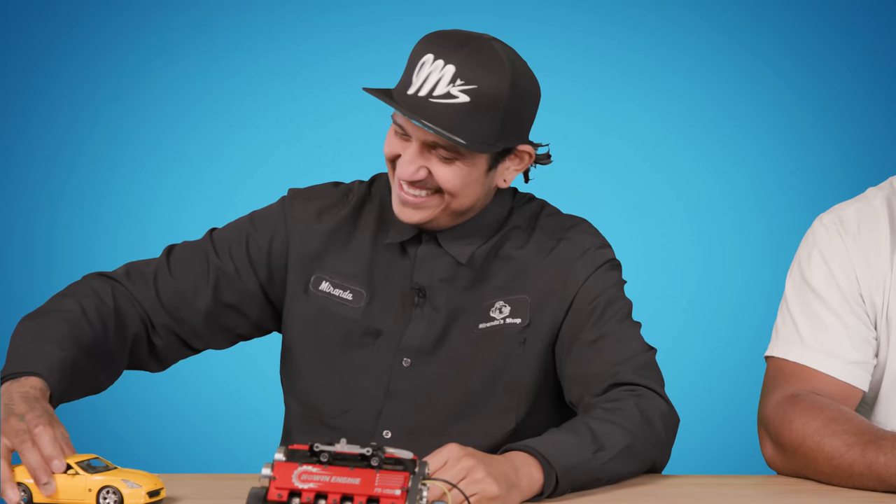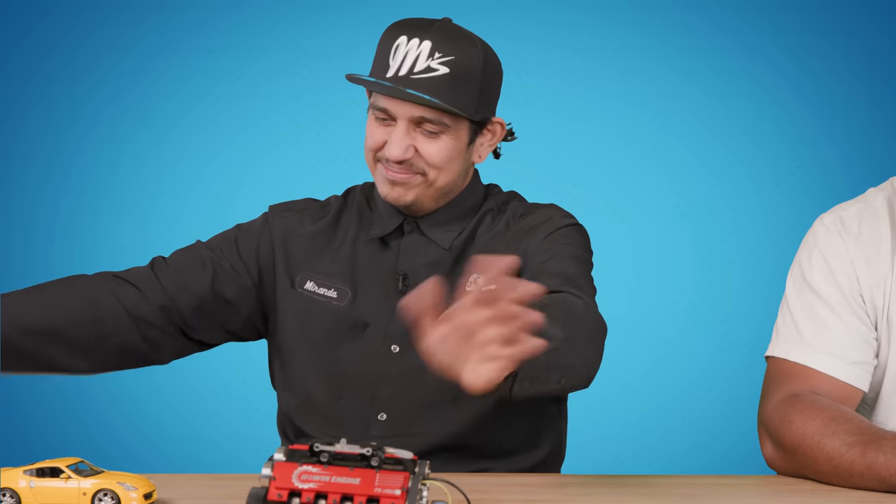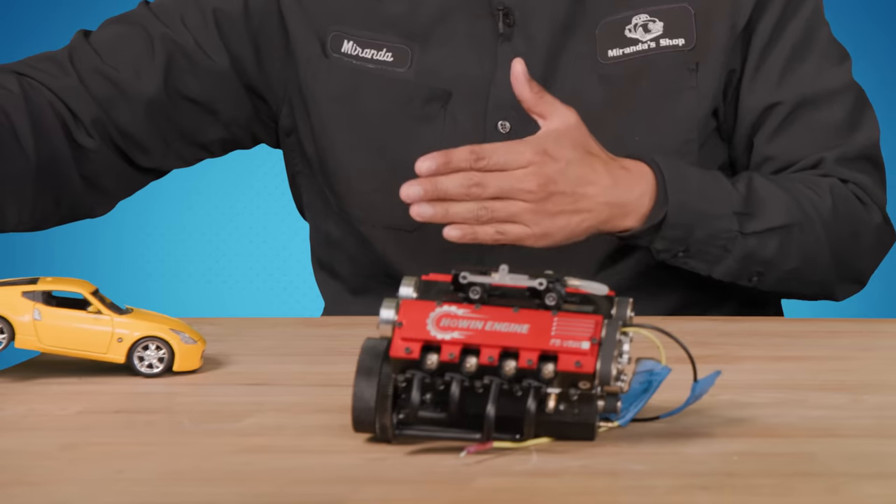He's moving the crank. When you push-start a car, you need to have a decent amount of velocity before you pop the clutch, because if not it's not going to start. Let's say you're stuck and the battery's kind of dead — you're at a gas station with a little slope. Put it in first gear, let it roll down, pop the clutch, and it'll turn right on.